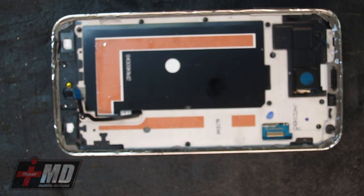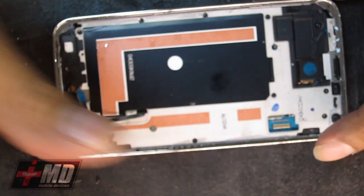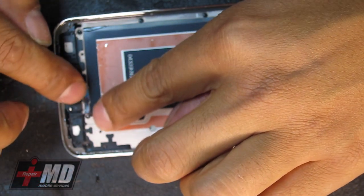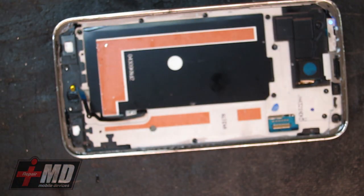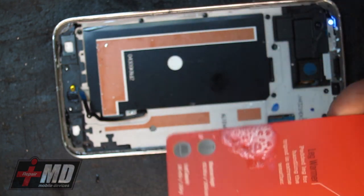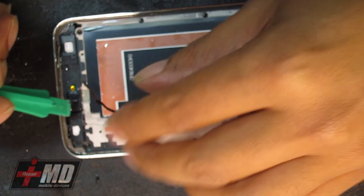Get it from my store for about 15 bucks. I use it for iPad and all my tablets — anything that requires resealing. Double-sided tape doesn't do it because if you leave it in a hot car, the adhesion will fail. So I'm going to re-glue this using 77 — spraying it just a teeny bit on here — making sure this lines up right and re-adhering this thermal sensor to the phone.